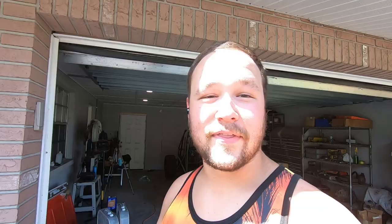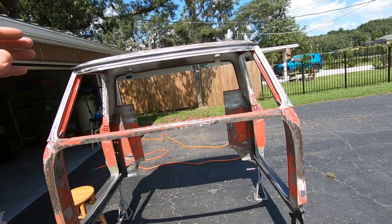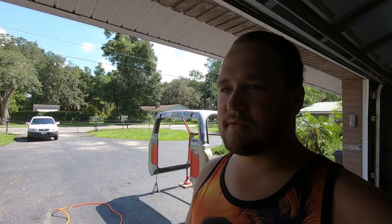It's the next morning. It's freaking hot this morning, so I'm trying to get as naked as possible without embarrassing myself - this is part of my 4th of July outfit. We've got the cab out here all set up ready to paint. I already went ahead and got it all wiped down with isopropyl alcohol - that's what I prefer to use on the final wipe down because it won't eat into the previous paint but it also removes grease and grime really well. We got our Astro Tools water separator hooked up to the air compressor. Ready to start spraying this thing. I've never really painted in a humid environment, so I'm really hoping it doesn't just go to shit. I've read a bunch of stuff online about precautions to take when spraying in humid conditions, hopefully we have all our bases covered.